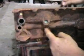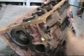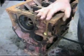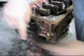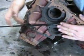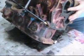That hole there is that boss that runs along the side here, and it's been drilled on the end. So the oil is coming out of here. Now from here, it comes across through here, up to here, and then you can see there's a boss on the side of the block here, and the oil comes out of the back of the block up here, where then it goes into the oil filter.